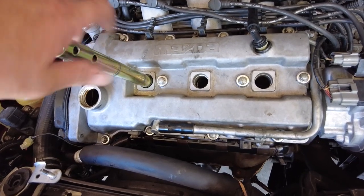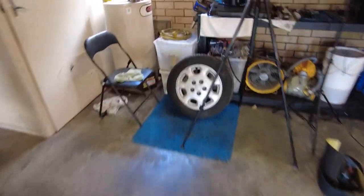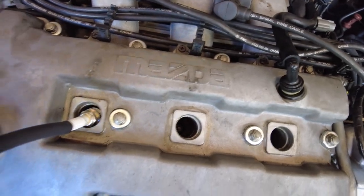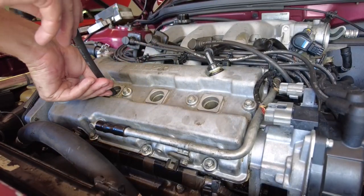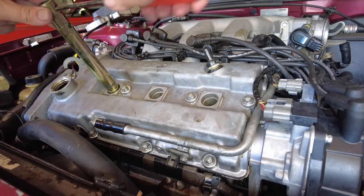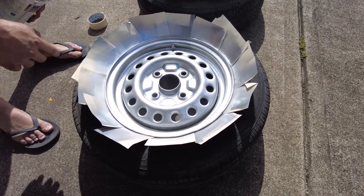The spark plug - I can't get it in with the socket so this is what we do: we get this rubber hose, make it like this, put the rubber on the end of the plug, and we use it to get the plug back in. One plug done. That looks good enough - you're right, Pop.